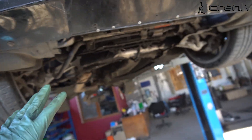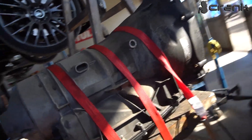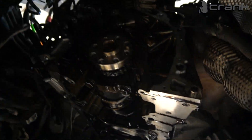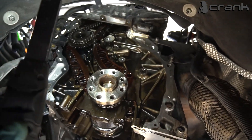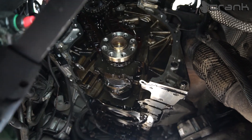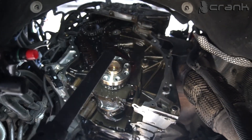We are a little bit ahead of the jump. As you can see, the gearbox is out and secured on the jack stand. Let me show you the timing chains — let me take a light, it's a little bit dark. This is the timing chains: the upper one and the lower one for the crankshaft and the camshaft. I already removed the oil pump. I am going to show you the slack of the camshaft chain and what the crankshaft one looks like.